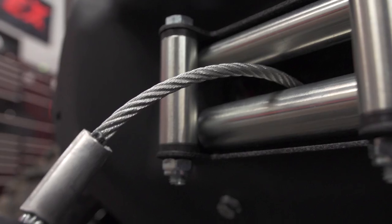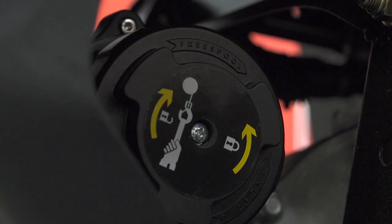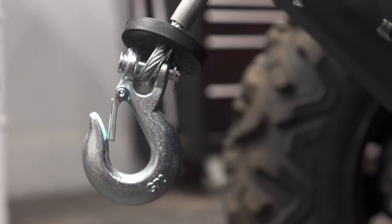This winch comes with 43 feet of it baled in, and one of the nicest parts of the Defenders, you don't need a mount for your winch. So if you bought a base or a DPS version like we have here today, your winch just bolts right in. There's nothing more than 4 bolts needed. It's nice and simple. And finally, I can't forget link mounts.